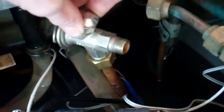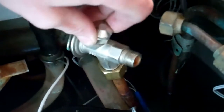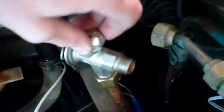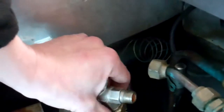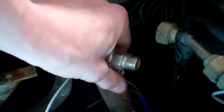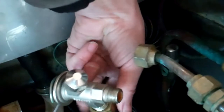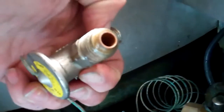Now here's the thing — I have not touched that and that is as found. It's finger tight, half a turn on it, three fingers. I've never known a flare come undone by itself to that degree. So I don't know what's going on there.